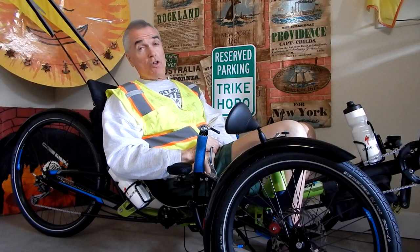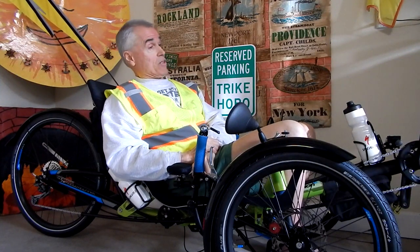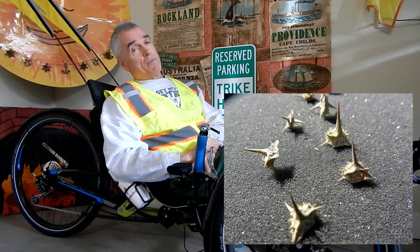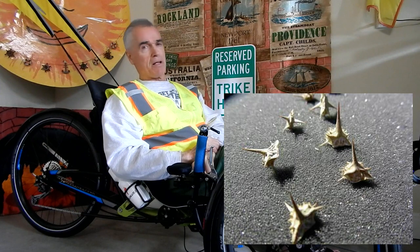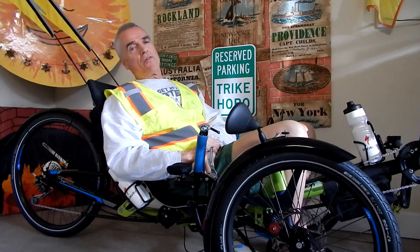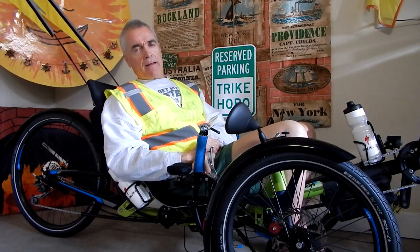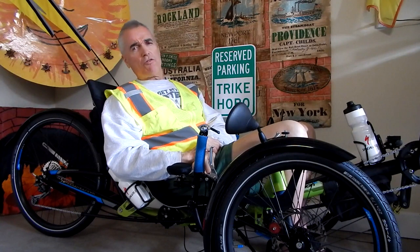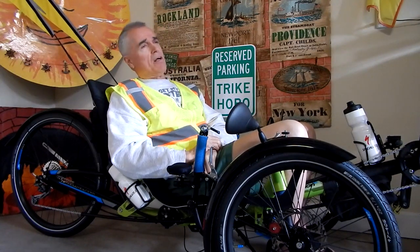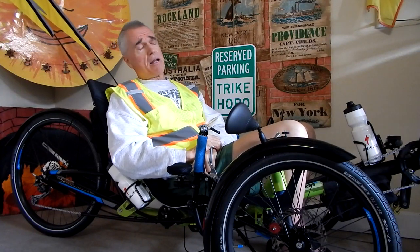If you're actually using the tires for off-road work in the desert or anywhere where there's goat heads, and goat heads show up not just in deserts, trust me, in forests, then they're worthless. They're worthless for anything beyond snow and sand. And I know this from hard experience. Four flats with the results that I just described to you, it's not some fluke like I just hit something just right and it flattened it.